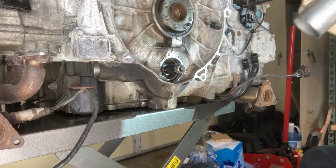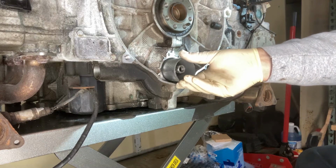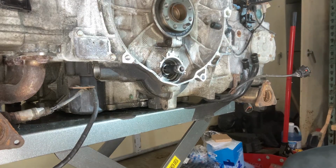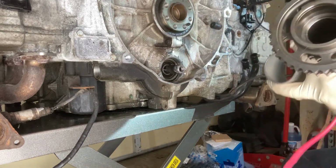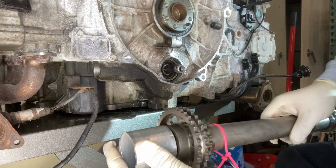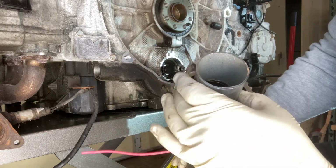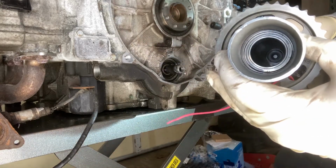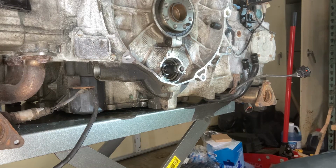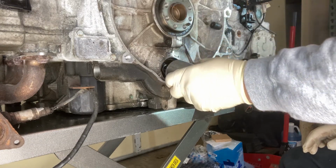Turns out that the 2-inch electrical conduit also corresponds quite nicely with the size of the outer diameter of the shaft. Again, I'll try to give you a view of this, but it's just about perfect. It's not going to interfere with the bearing when it starts coming out of the hole. Just almost like it was made for it. So we're going to use that as our tool sleeve. I don't know if that's the proper name for it, but that's the name I'm using.